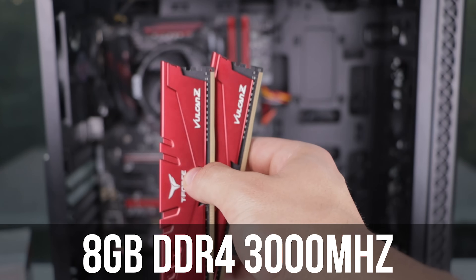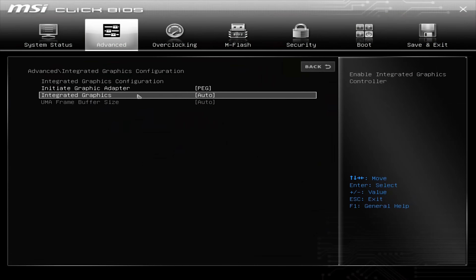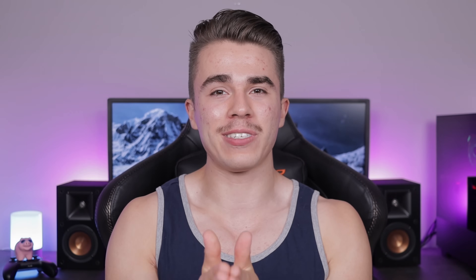For the RAM I have 8 gigabytes of DDR4 clocked at 3000 MHz. I'm leaving the brand name out because as long as you choose an 8 GB dual-channel set at 3000 MHz, the brand doesn't affect quality. I'm choosing higher speed because higher frequency RAM works really well with Ryzen processors like the 3400G. One important thing to note: since the graphics card is built into the processor, it doesn't have its own dedicated VRAM, so it uses up to 2 gigabytes of system RAM as VRAM. That leaves you with 6 gigabytes of memory for gaming, which as you'll see from the benchmarks wasn't that big of a deal.